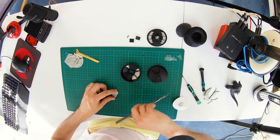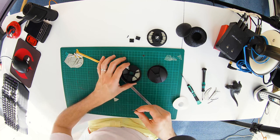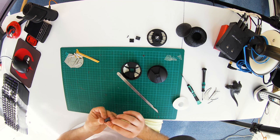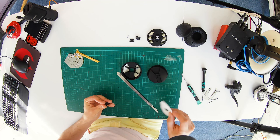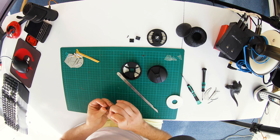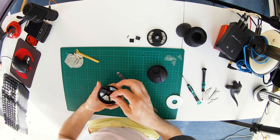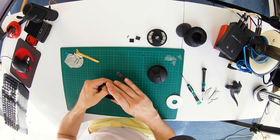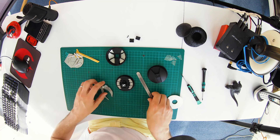The effect that this has on the sound is very minimal — I doubt we'd see much on the graphs. What it does is help stop resonances, gives you slightly more space in there because we've taken out the big lump of felt and replaced it with something smaller. It also damps the ear cup so it doesn't ring or bounce sound back through the driver. Very subtle, but while you're in there you might as well do it.